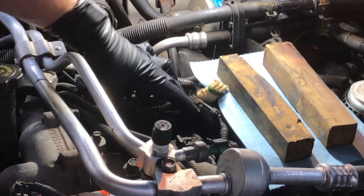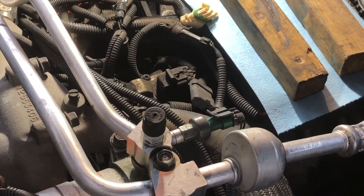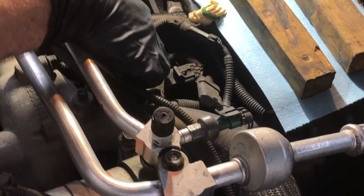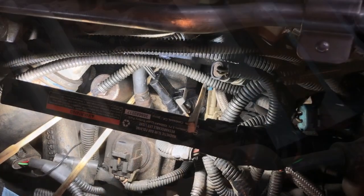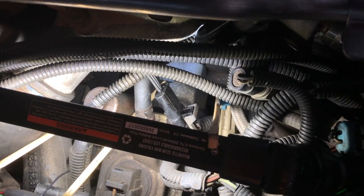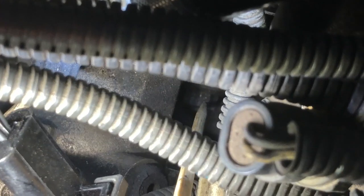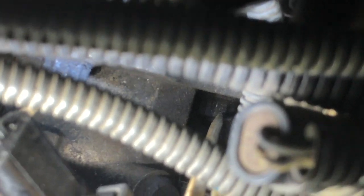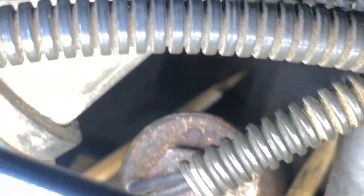This is our injection pump right down in here. You've got the upper radiator hose coming into the coolant crossover, and the injection pump sits right under that. There are three mounting nuts on here — I've got sticks pointing to each one. There's one right on top of the injection pump and one on either side at the bottom, so the mount is somewhat triangular in shape.